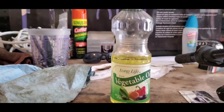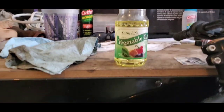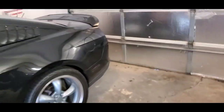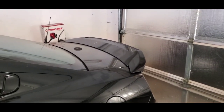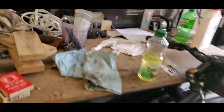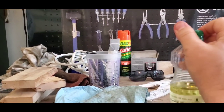What I've done in the past is use regular vegetable oil. Oil naturally soaks into the glue, dissolves it, and makes it really loose so you can just wipe it off. I actually learned this when I was doing a spoiler — I took up the stock one and put a GT spoiler in, and they had it all glued down. I used Goo Gone and all that sticker removal stuff and none of it seemed to work. I was scrubbing, scraping with a scraper and it just wasn't coming off.